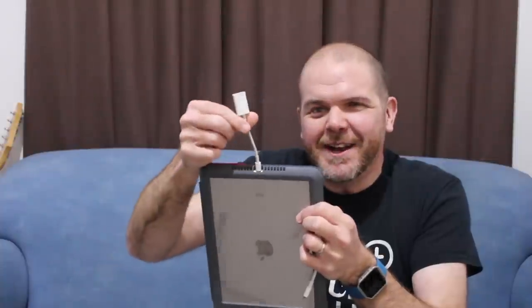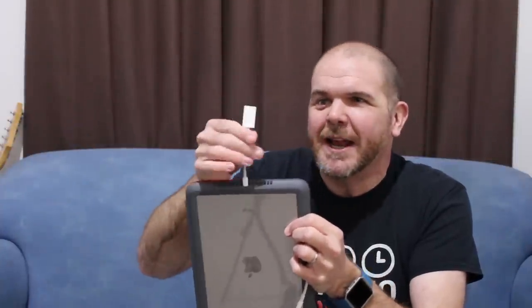With the basic adapter, you plug whatever device you want to use into the USB end, the Lightning goes into your device, and you're away. But the problem is as soon as you plug this into your iPhone or iPad, you've got no way to charge it, so you'll quickly run out of power. The benefit of the Lightning to USB 3 adapter — which is slightly more expensive but a lot more versatile — is that once you've plugged it in, you have both a USB port and a Lightning port, so you can actually continue to power and charge your phone or tablet at the same time as recording.